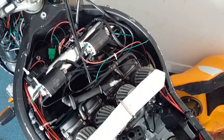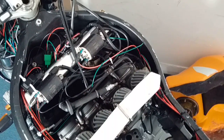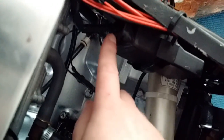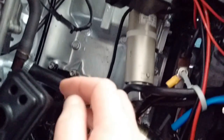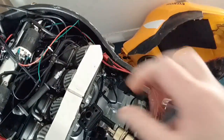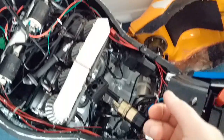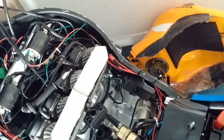What I need to do now is try to get to the bottom of this problem. I think I'll start by looking at my wiring. I've taped all around the top end of the CDI where I've wired it in, so I'll probably remove the CDI, take off the cable tie, cut the tape off with a Stanley knife, and have a look at the connections to see if they still seem sound. If one or more connections have come apart, then I'll know that's the problem.